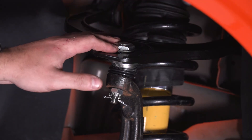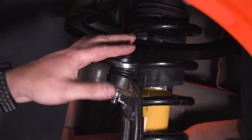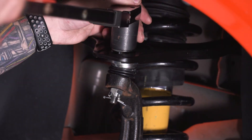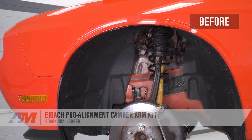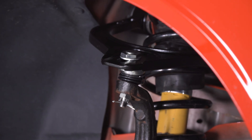At this point we need to torque down the top adjustment nut. Eibach specifies 120 foot-pounds as the torque spec. I've got my Snap-on torque wrench and a 27-millimeter socket to get the job done. Once you hear that snap, it's torqued down. At this point, throw your wheel back on, put the weight of the vehicle back down on the ground, head under the hood, look up the torque specs for your specific model, and torque down the bolts that hold the control arm to the body of the vehicle. Repeat this on the other side and you're good to go. That wraps up my review and install for the Eibach Pro Alignment Camber Arm Kit, available for the 09 and newer Challenger — pick yours up at americanmuscle.com.